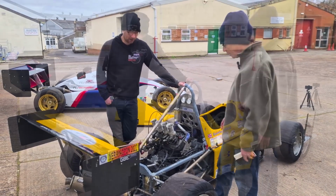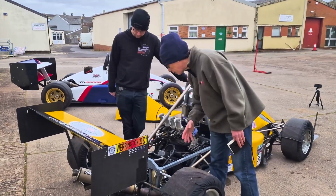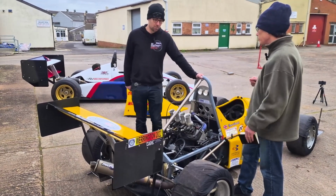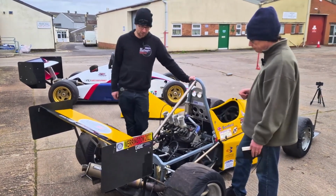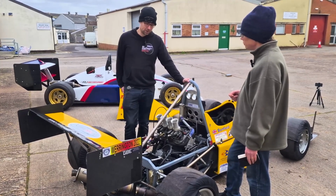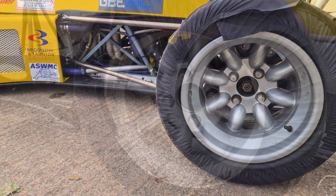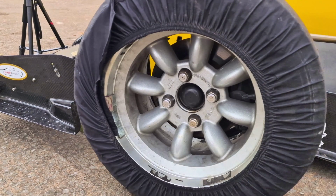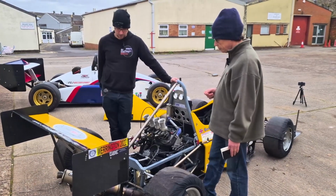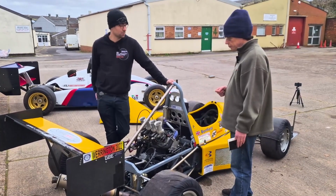Yes, yeah. So looking inside the wheels, we didn't really touch on it at the front, but we can see the brakes there, the obviously drilled discs. What we're looking at, we've got AP calipers, I believe. No, Brembos on this. Oh, Brembos on this one. This is one of the rare ones that actually runs Brembos. Okay. But yeah, it's 2-pot Brembos. The discs on the rear are drilled. The front ones are actually grooved. They stopped making the drilled ones, I think, back about 2004. Okay. But again, as we mentioned earlier, it's not so little mileage that actually the discs will go on for forever almost.